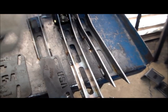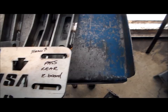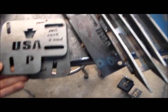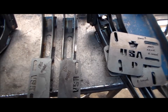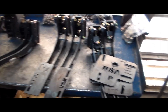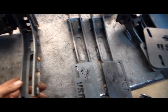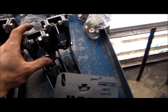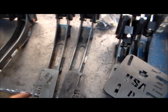This whole entire kit — everything's adjustable two to six inch. You could also go forward and back half inch for more fine tuning. The order that I like to do is: mount your cab, mount your bed, and then mount your running boards. Once you mount your cab, you start with your front cab mount, that way your running boards are pretty much already set and dictated. The rears actually mount to factory holes in the frame, so those are kind of dictated. Then the middle ones you do last, wherever you end up with your front and your rear.